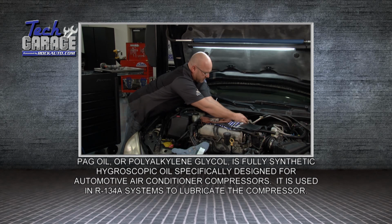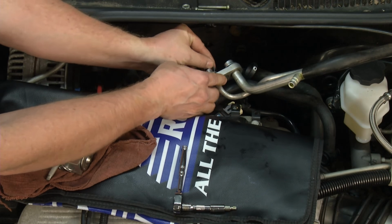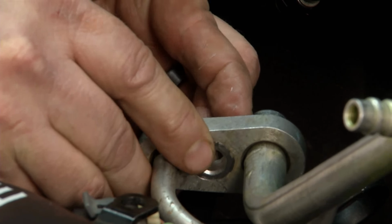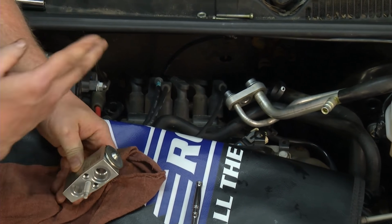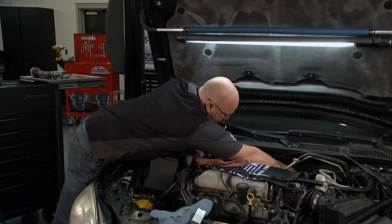Let's go ahead and do the small one. Same thing. Here's the new one. Goes on. Got lots of oil and lubrication there to get a good seat down on there. Now, I've got 2 anchor bolts, just like the old one, to go back in and get it reinstalled. We'll come down here, take your time and work it in. You'll feel it seat down on those O-rings. It can only go one way. Right there, you can feel it seat very clear.